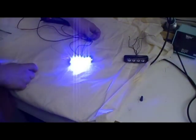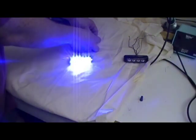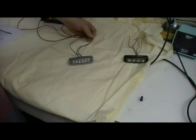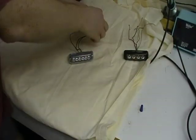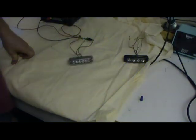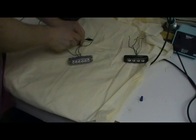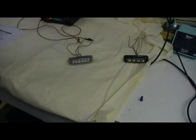In order to exit the half steady, half flashing mode, take the green wire to ground and hold it until it flashes six times. That will toggle you out of steady burn half and flashing half. Now you're back to split flashing. Remove the green with white wire if you want, and the whole thing is flashing.